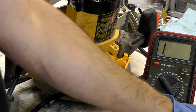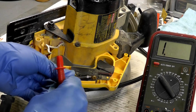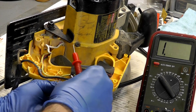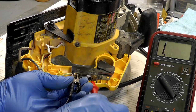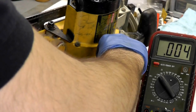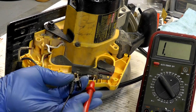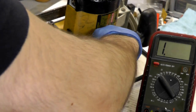If you were to test the switch, you could test it this way — again, a little different with an electric brake switch. To test for continuity on the switch, just for open and close, attach one terminal to each of the top screws on the switch, then pull the trigger. Open circuit, closed circuit — that works beautifully. So we know that the switch is okay, because we did a continuity test throughout the tool and the current does flow, and we did an open and close test on the switch.